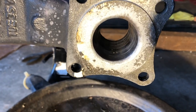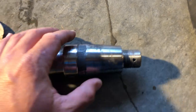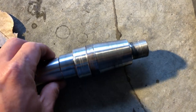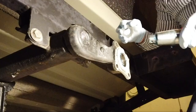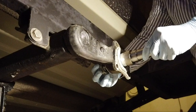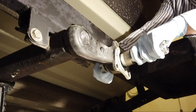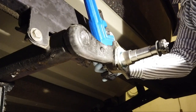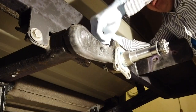When I got the axle tube cleaned up, I was a little concerned because there were some grooves or score marks in there. It doesn't appear that the old spindle was the source of them from spinning around, as there are no witness marks on the tapered end. Whatever the purpose of these are, they didn't seem to interfere with installation of the new spindle. Installation is pretty straightforward — I just slipped the tapered end into the axle tube. I put a little bit of marine grease on there since I figured it couldn't hurt, then tightened down the axle nut on the back and we have ourselves a new spindle.